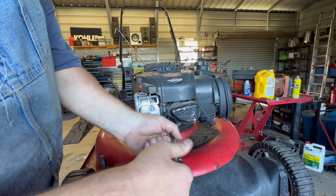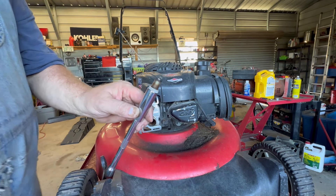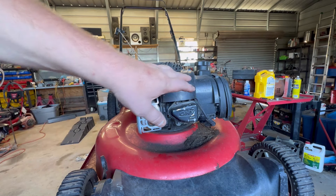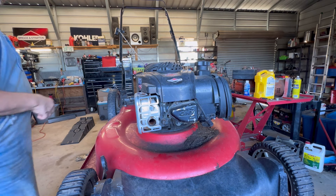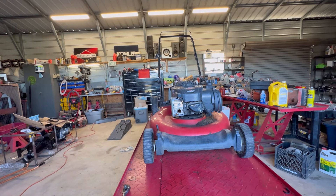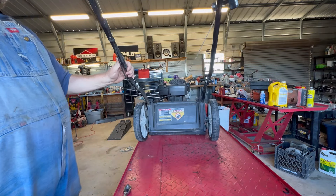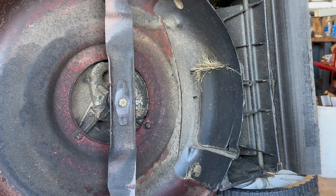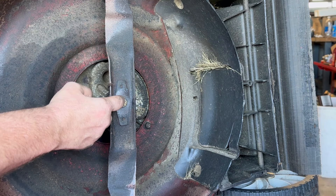In just a second I'm going to get this camera set up right on the end of this crankshaft so that we can pull it over and see if it's bent. That spark plug doesn't look too bad at all. Now when you flip a mower over you want to flip it so the carburetor is pointing to the sky. Y'all are about to get the first look at this thing to see if we've got a bent crank. Look right here at this bolt - I'm going to pull the rope and let's see how bad it's bent.